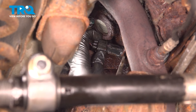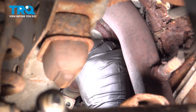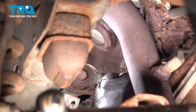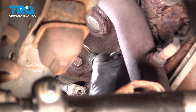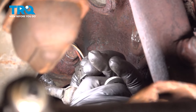We've been soaking this down with some rust penetrant working the sensor. We just need to pull this out with that O-ring. I'm going to go ahead and wiggle that sensor out of the block. We're going to pull this down and disconnect the connector. We couldn't pull off the connector because the tab that you press is up against the flange for the transmission area. So we're going to press in on this little tab and wiggle it off of the sensor.